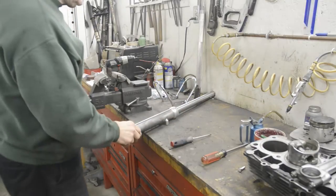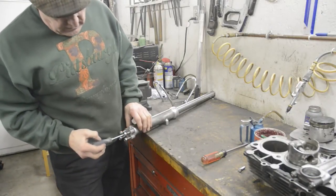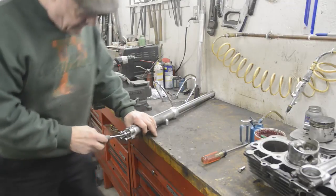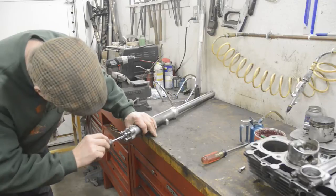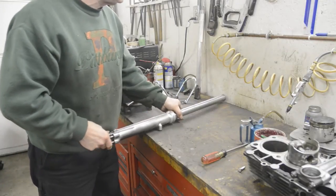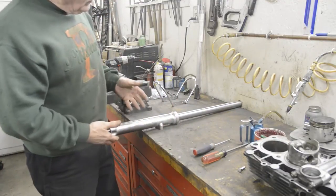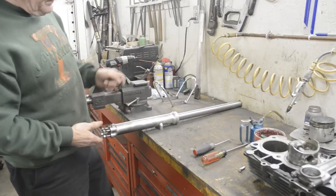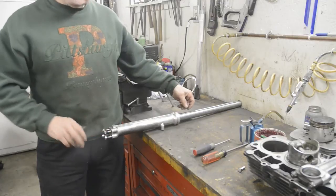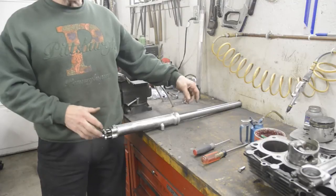So you spotted my deliberate mistake there. Of course, I haven't got the damper rod quite into the bottom. So you just stick a little rod in to get it centered. And now the screw has gone in. Like me, you were probably wondering why I was screwing and screwing and screwing with about a half inch bolt and it still wasn't there. So I'll mention something else here to assist you when you're taking them out. The actual damper rod, of course, can turn in here. So once you've got that Allen bolt into a certain tightness, it'll just start to turn.